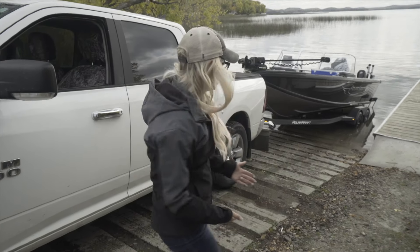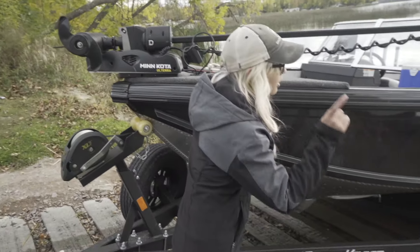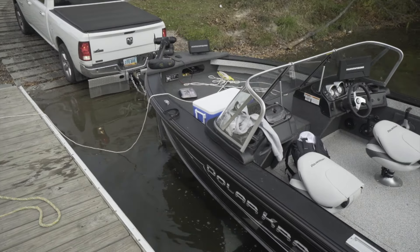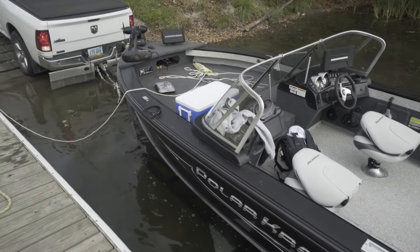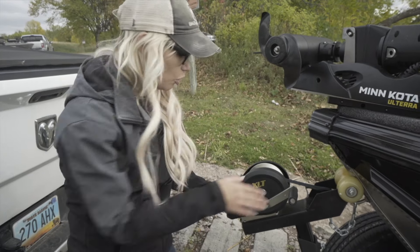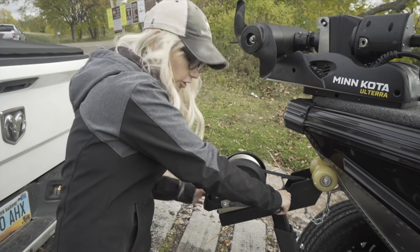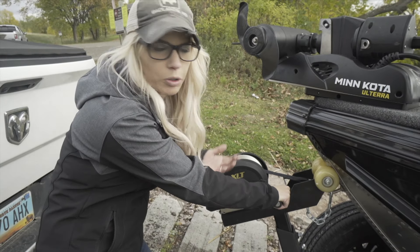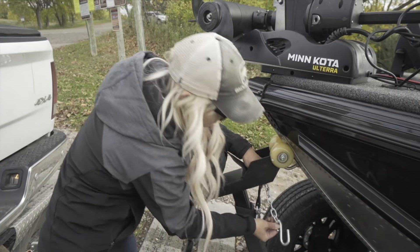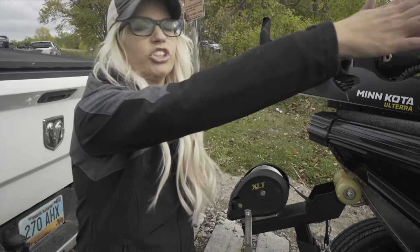Take the rope and put it on the dock. In my previous video I talked about how you can attach it to the truck — that's linked. Otherwise, just hook the rope to a cleat on the dock, leave yourself lots of rope, and then detach your boat. Take the tension off the boat, click it down. There are many different boat styles, but you're going to want to release it and release the safety chain. Then just slowly back it up and the boat's just going to slide out.